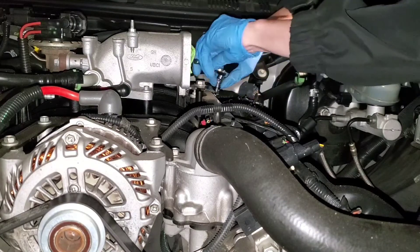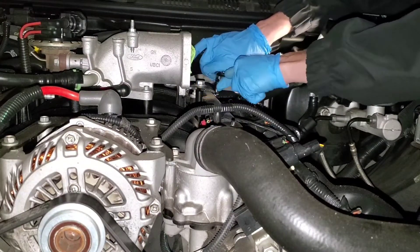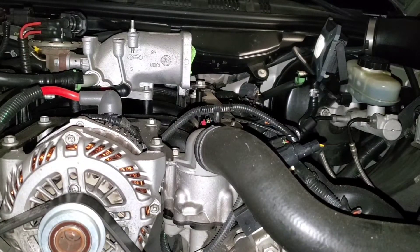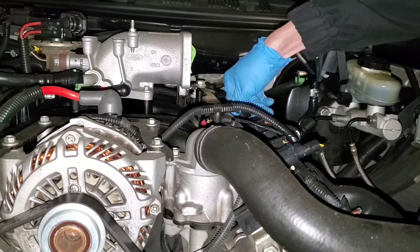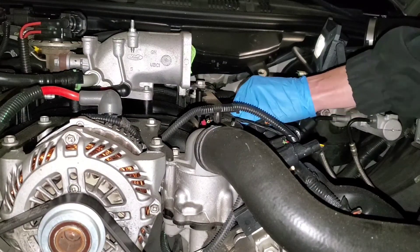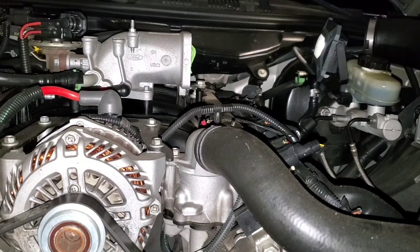I've got my handy dandy quarter-inch ratchet with the universal joint, which has saved me on numerous occasions. I'm not sure what the torque spec on the coil pack bolt is, but I'm just going to tighten it down pretty good, not too tight — and that one is done. On the third coil pack connector it wouldn't click in, so I had to really jam it in there and finally it appeared to be in correctly because it won't come out without pressing the release tab. Okay, so this side is done. I'll be reinstalling the throttle body and air duct, and then doing the other side.